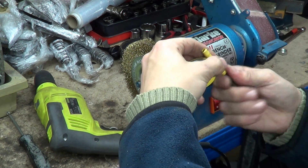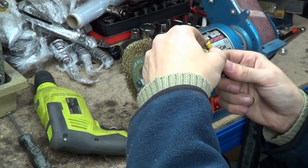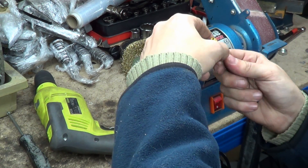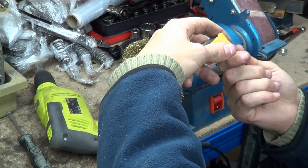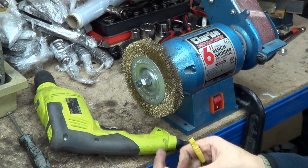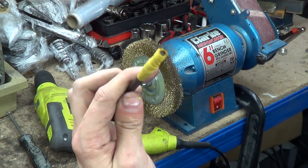The reason for doing this is to protect the valve stem from the jaws of the chuck. Because we want to try and keep the valve rotating, so we've got quite an ample amount of tape on there as you can see.